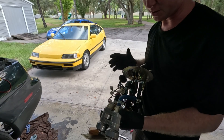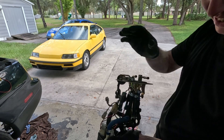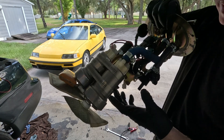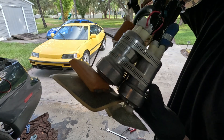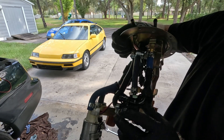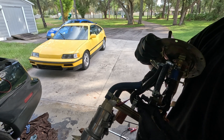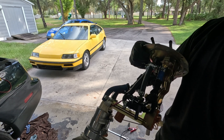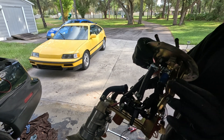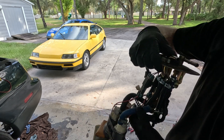So this is my factory-ish fuel pump setup. As you can see, it was not fun getting out of there — it actually ripped off a hose just pulling it out. I used hose clamps to hold the two 485 fuel pumps together, and then did a Summit Racing Y-connector in the regular fuel line. I didn't want to use accordion hose, though the new fuel pump setup does have accordion hose meant for ethanol and the correct fuel lines all ready to go.